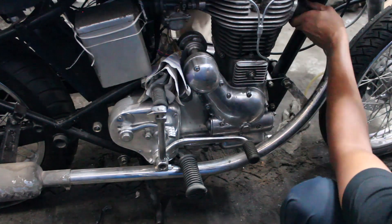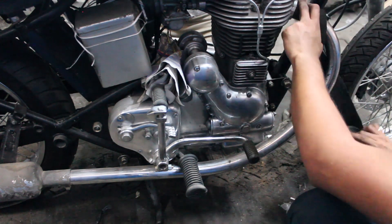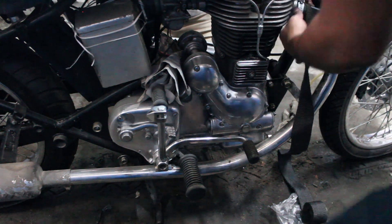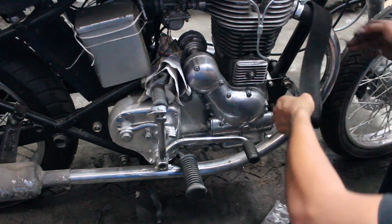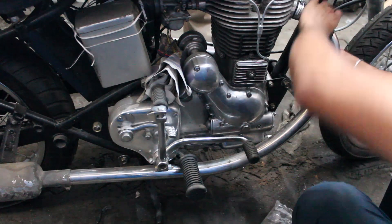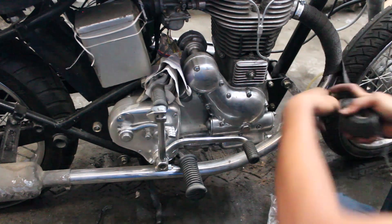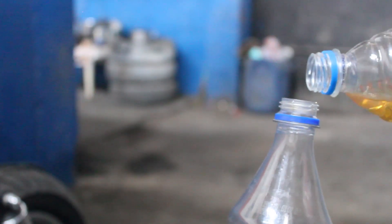Here I am wrapping the exhaust band pipe using a belt covered with insulating material. While this belt increases the overall look and appeal of the motorcycle, it also creates a safe space for our legs. I forgot to note that the insulating material used here is fiberglass — you can think of it as very fine spike-shaped pieces of glass. If fiberglass touches your skin it can cause really bad irritation and itching. Therefore while working with it you need to follow all safety instructions: safety gloves, safety goggles, a mask, etc. By the time I realized the belt had fiberglass on it, it was too late and I had to pay the price for the next two days.